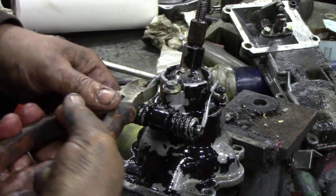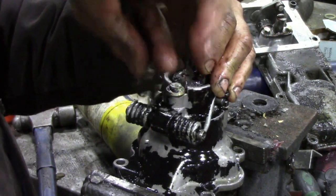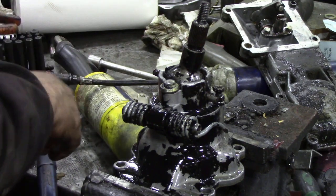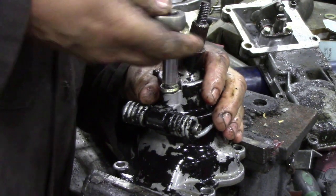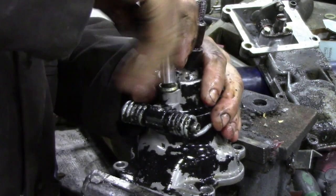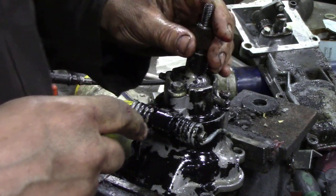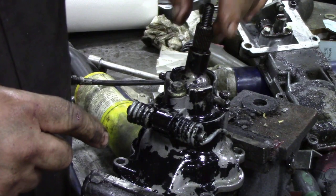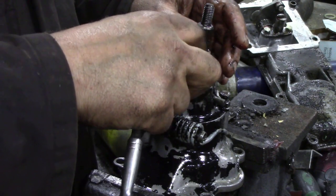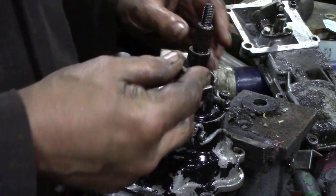Right, to get into this - quite easy. Take the spring off, the stops move just to one side - maybe pliers aren't the best idea but that's all we've got at hand. Take them off, take this little bolt out of here, because this is the thing that holds the ball in. Don't be tempted when you're moving gearboxes to lift it by the shaft - the only thing holding it in is this little bolt and it's not really enough. We might as well clean this up and grease it - it's full of grit and dirt.